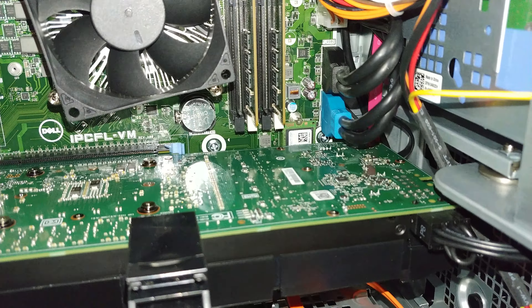These hard drives didn't come in here — I'm just putting them in to see how it would be for future upgrading. These are just two 500 GB drives I'm going to mess with. It's a little bit of a pain routing these cables if you want to put extra hard drives in here. Get the right-angled ones — they'll be much better, because that door is so close to these. I just stuck it in that little clip to help hold the cable so it doesn't get damaged, and it's not near the fan down there.